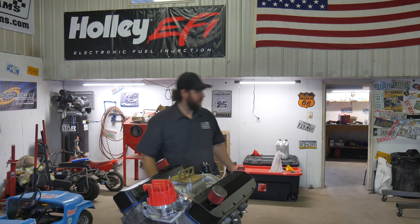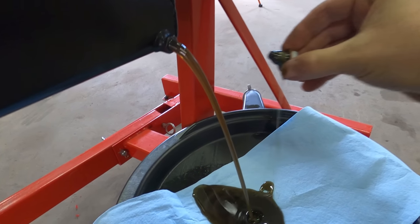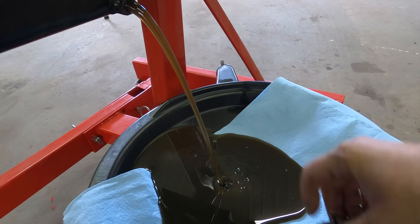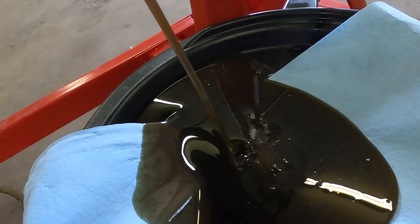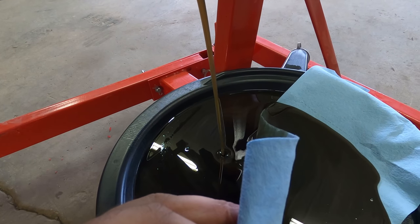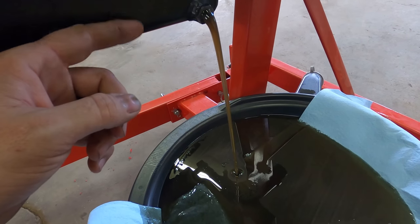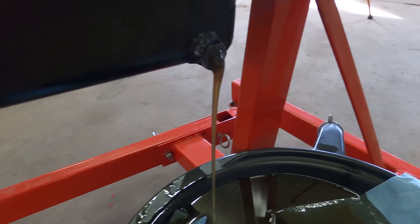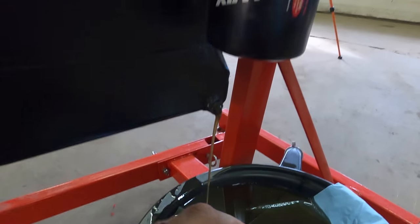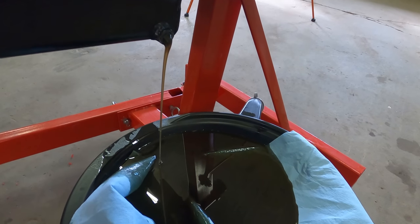It's really typical to see some metal in here - that's ring material - but we can see pretty easily if it's excessive, and that'll be towards the bottom of the pan. Well, so far the oil is looking great. There's just a little amount on the magnet, and the rest is usually caught in the very bottom of the filter, so we're going to cut that open in a minute. But yeah, this is looking good.